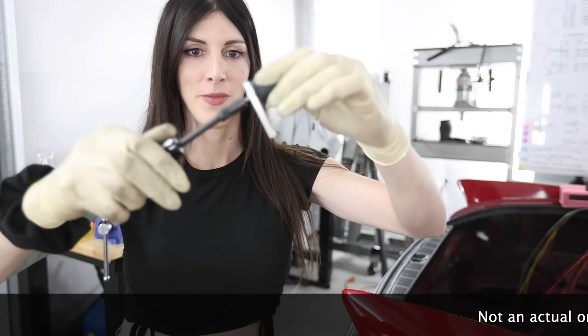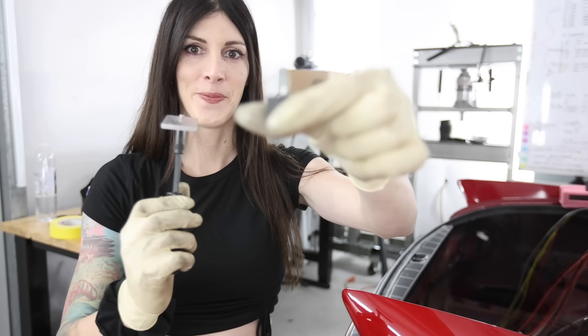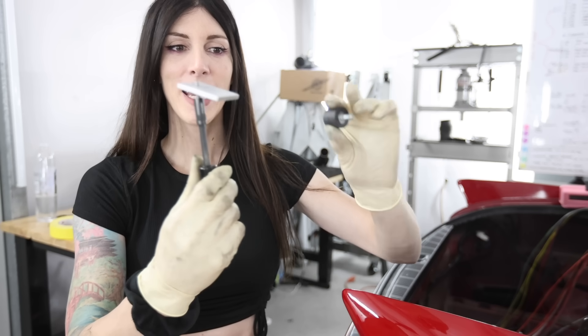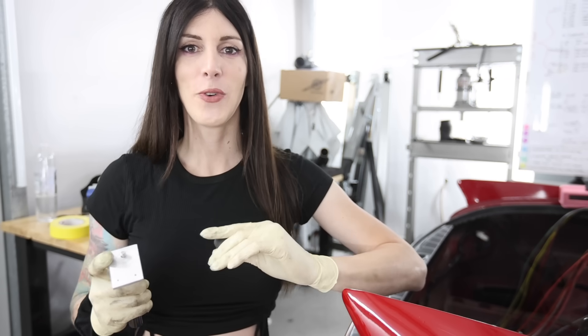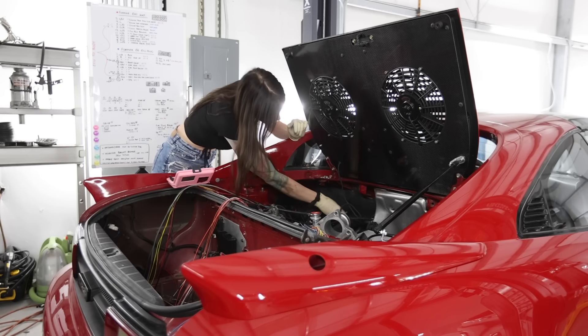Next up on what contraption shall Sarah make — this right here is a bushing on a stud. Bushing and stud go on firewall, plate goes on bushing and stud, and the solenoid for the electronic boost controller mounts to the firewall. Problem solved. It's a shock mount. This should fit because it's a quarter-twenty — and it does.